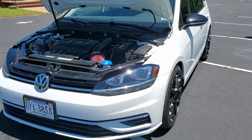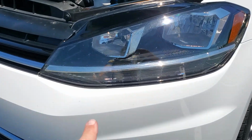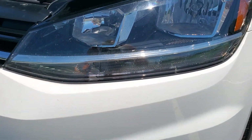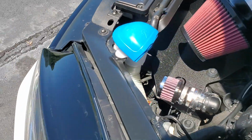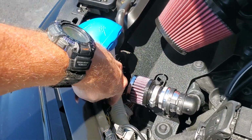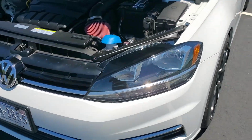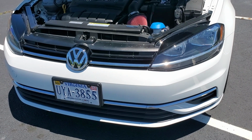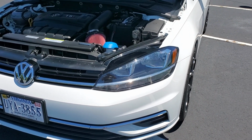On the high beams, they're H9s. That's the inner one, that's an H9 bulb. It's super easy to install because you actually are going through the innermost entrance, toward the center of the car, for that light. That's pretty easy access on both sides. That was easy. It took about 10 minutes. Blinkers are in the same cavity in the light, so those are also super easy.